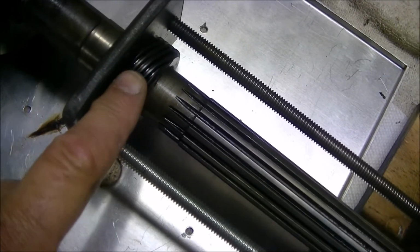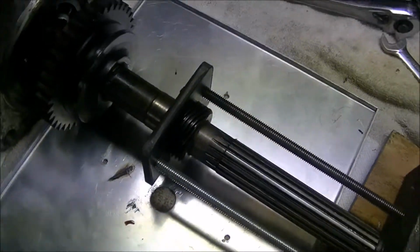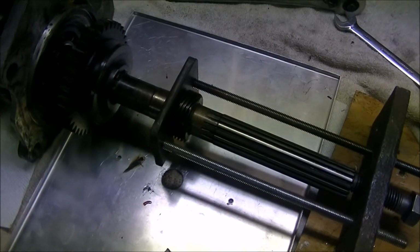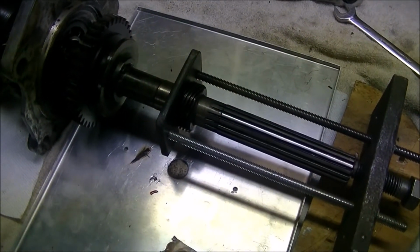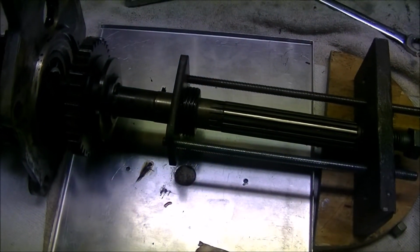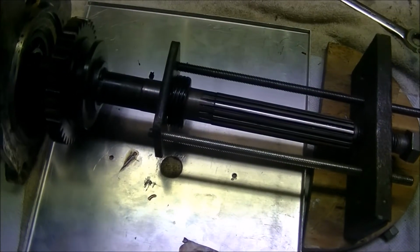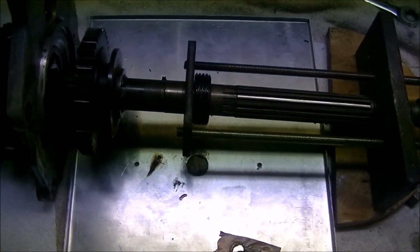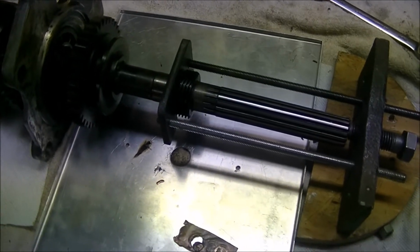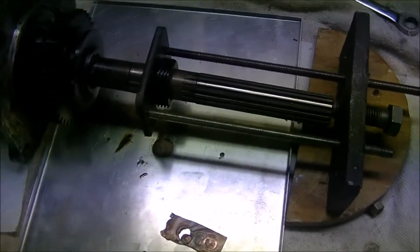I have to take this off to get it disassembled, but also I have to put a different part number gear on, because since I changed from a 307 to a 331, the gear for the 331 and lower axle ratios is different than the 307 for some reason. So I do have one of those ordered from Studebaker International, and I got the correct pinion ordered.